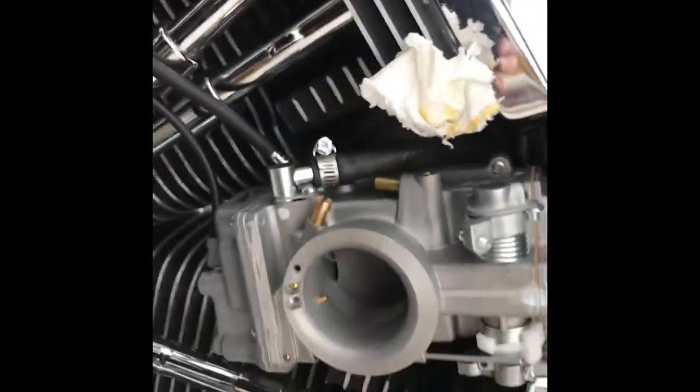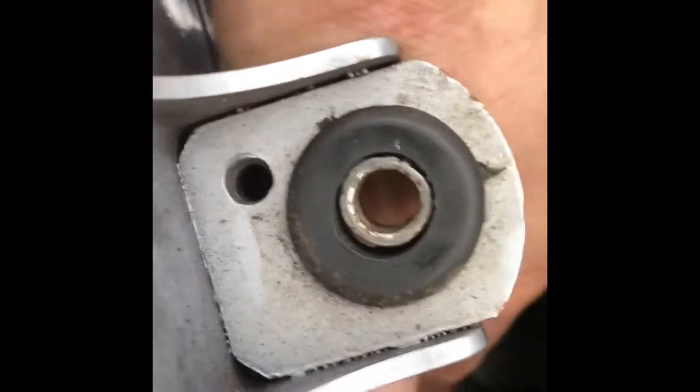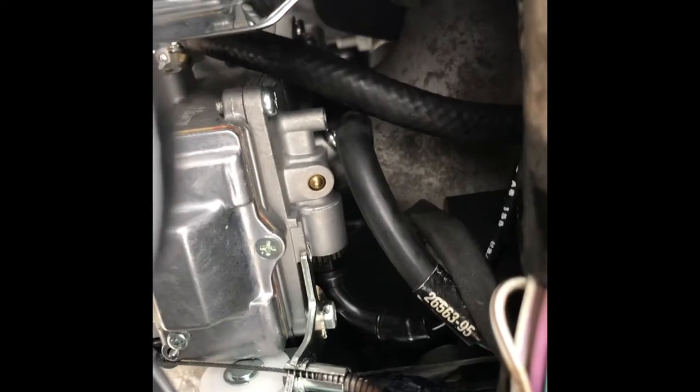The carburetor has gone back in. On the new one there's only about two or three millimeters gap between the cooling fin and the edge of the carburetor, and an equally small amount on the other side. From the top you can see the rubber gasket has gone on fully all the way around — no clean metal showing anymore — and the cables are seated in the holders properly. The vacuum pipe went on as a straight push, and likewise the fuel line was a straight push on with a supplied jubilee clip.